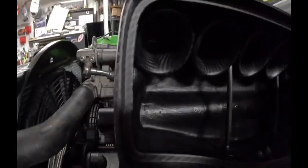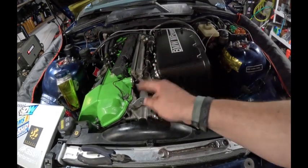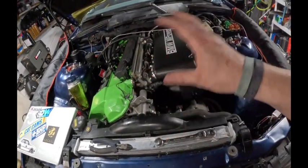We're also trying a number of intakes. This is the Turner Motorsports CSL-style airbox — air filter in, split in half, you can see the runners, which are actually slightly shorter than a stock S54 intake to increase top-end power. That's one intake we'll test. Michon from Rabid is supposed to have one of his prototype airboxes designed for this ITB-swapped car. We're also going to try Travis from GDM's billet aluminum manifold — originally designed mainly for turbo setups — but we'll have to completely remove the ITB setup to try it since it uses straight runners. It should work best with the porting on his head.